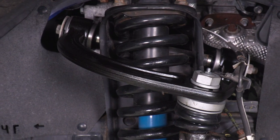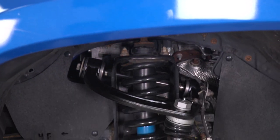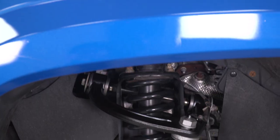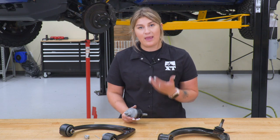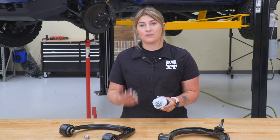As you can see, our control arm has a bit of wear and tear, and even on our ball joint you can tell it's leaking a little bit because of the thrown-off angles. With this new option, you're not going to get any of that because this is fully adjustable — up to four degrees of caster and two degrees of camber. So if you do add a lift, your alignment technician will be able to adjust for that, and there is also a guide on how much caster or camber you'll technically need in the install instructions. This is going to be a very durable setup: you are getting factory-style bushings with a forged steel construction, and you're also getting an X-axis sealed flex ball joint, which will be very durable and able to hold up in the long run. You're also getting a Zerk fitting up at the top for greasing and easy maintenance.